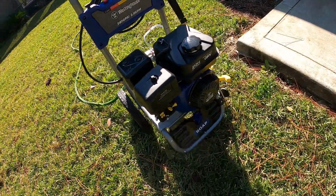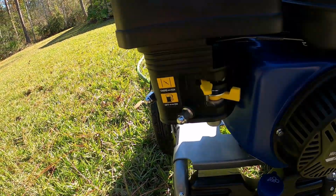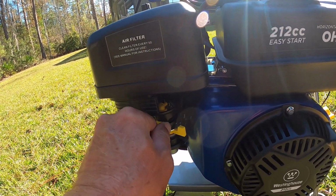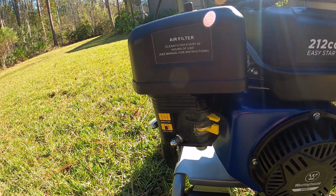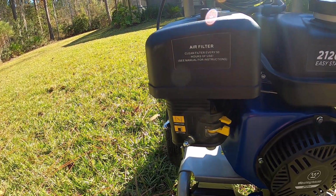Couple things. Make sure you turn it on. It's an on and off switch. Okay. And then you have the gasoline on and off switch. Want to make sure that's on. And you can choke when you first start it. So you want it on choke, pull it a couple times, and then turn it off at choke. But yeah, don't keep pulling unless you turn it on and turn your gas on. Aight? Okay, here we go.